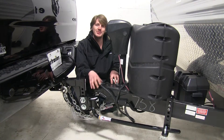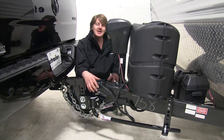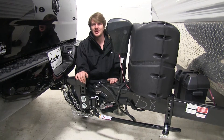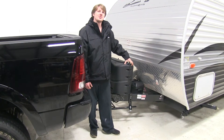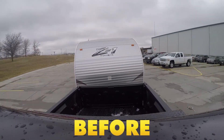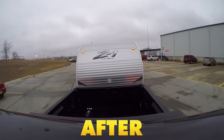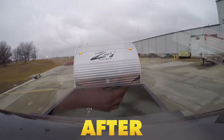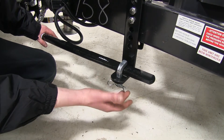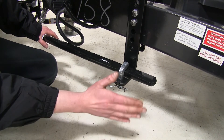Instead of having a single connection between your trailer and truck, the ball mount, tension arms, and brackets evenly support the weight of your trailer across its components and transfer that to your truck. Another issue you can run into is when you make an evasive maneuver, swerve around a pothole, your trailer can sway behind you. This Fastway system is going to help correct that issue as well, reducing that amount of sway. The L-brackets have a friction material on top, so when your trailer starts to sway, it's going to provide contact with your spring arm to help correct that sway more quickly.